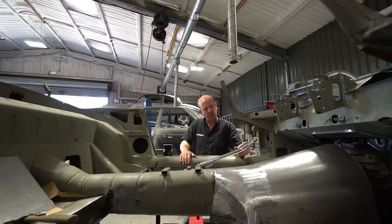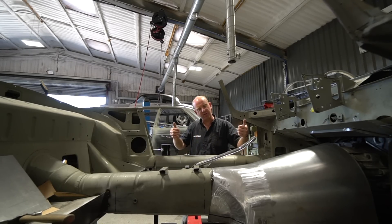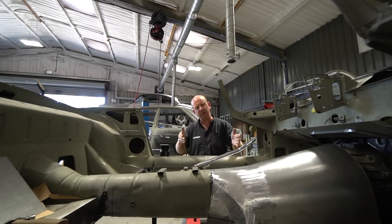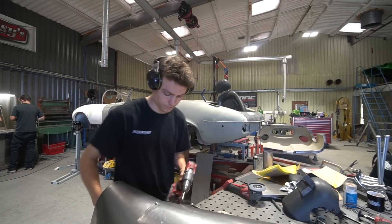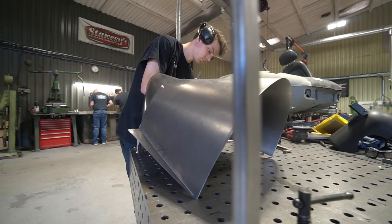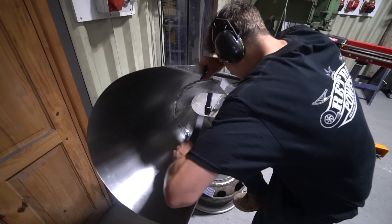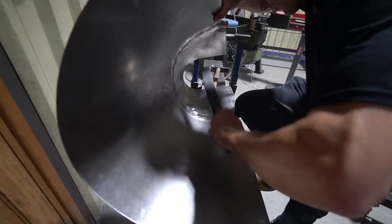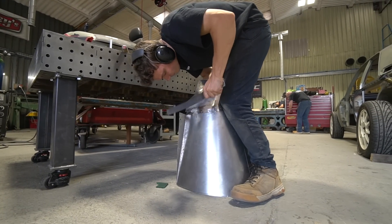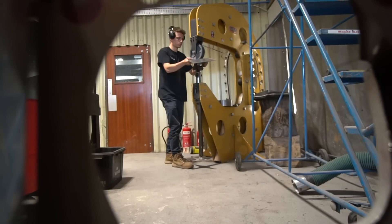However, that method is quite hard. None of our rollers have side rollers, so the sheet slides across and you have to improvise a shoe on the side. It's also hard to control the radius on both ends and to manage where you want a straight section at the bottom of the cone. What we find is actually a better way of making a conical section is to use the English wheel, fitting a polyurethane-tired caster for the upper wheel.